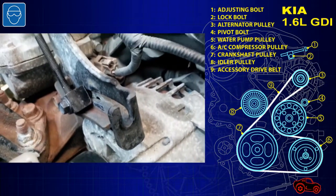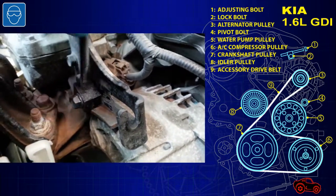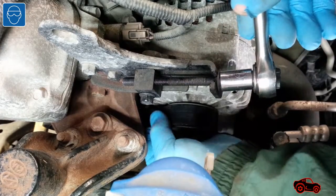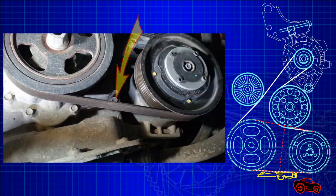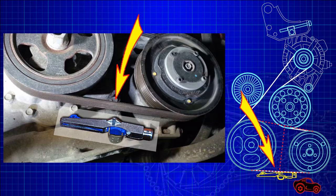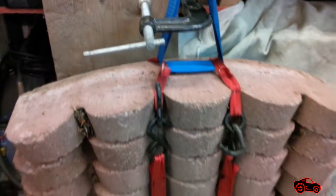I verified the routing and refitted the tension bolt back in place. Next, I screwed the tension bolt to exert a medium tension on the drive belt. To adjust the tension of most drive belts, it's better to check the tension with the longest accessible belt span between the two pulleys. Because the belt span between the two lower pulleys was only 7 inches long, I was not sure about the tension reading accuracy of my cricket gauge, so I decided to build a setup with two pulleys and a drive belt to perform some tension reading tests.